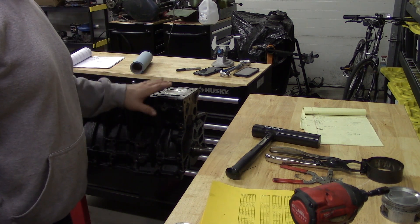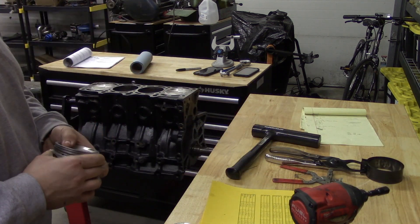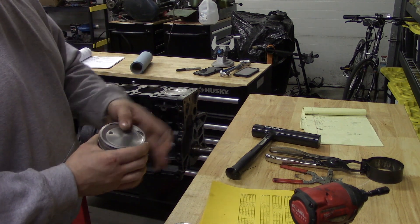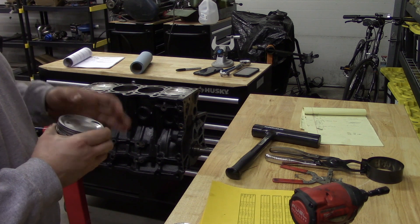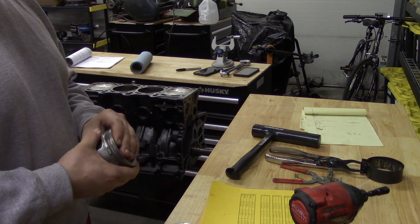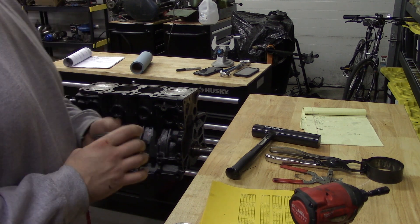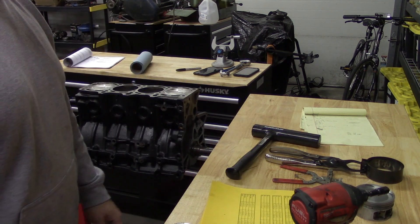But that'll be it for this video today. Our next video is going to be a comparison for the 3S and 5S stuff. I've CC'd each one of these pistons in this engine and measured the dish of it. I'm going to use that measurement and a few others to calculate my total compression ratio, but that'll be something we get to later on. The next video will be comparing these to a standard size piston versus some 3S stuff — we're going to do some comparisons on rigidity, CC volume, and a few other things.